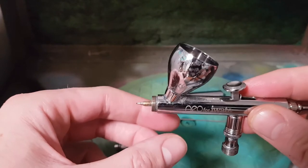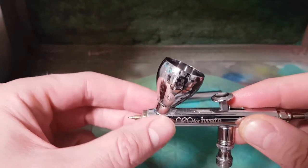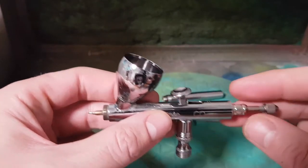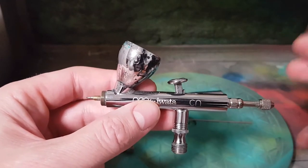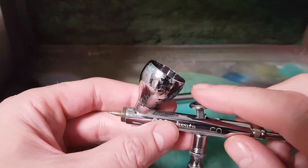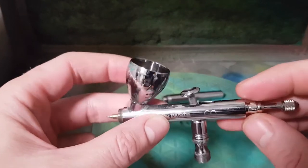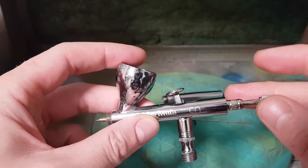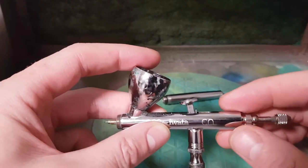Siphon feed is the exact opposite. So you're fighting gravity, and it's basically a suction action, so to speak, that draws the paint up into the airflow and shoots it out. I prefer gravity feed. Some people might swear by siphon feed. That's something you gotta shoot from the hip from, and basically make your own decision. If you are absolutely indecisive, I say go with gravity feed, because why not let science do the work for you? I'm sure there's science in the siphon feed, but I had one before and I didn't like it. So anyway,